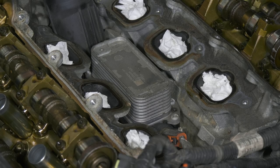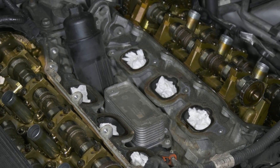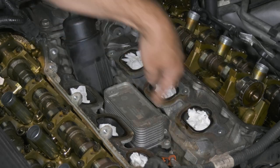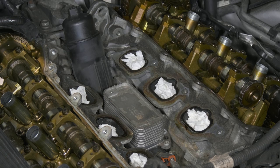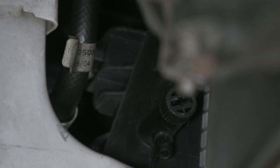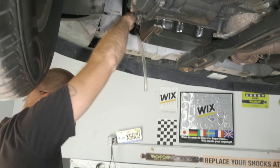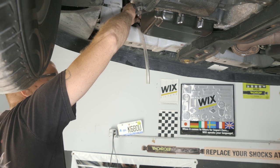Now we're ready to replace our oil filter housing and cooler. The first thing we're going to have to do is drain the coolant. We're going to get underneath the car and find the petcock to drain the coolant out, because we have coolant flowing through — there's a line right here and then we have the other going into the motor. Here we are under the car on the driver's side of the radiator. We have our petcock right here with our little tube. I'm going to put a little piece of hose on there to direct the coolant out into my catch can so it doesn't end up inside the frame rail. I'll use a pair of small channel locks to loosen it. I do have the radiator cap off to help it flow out.